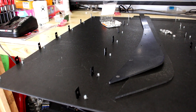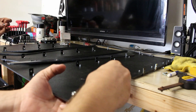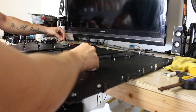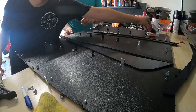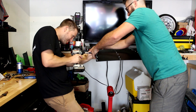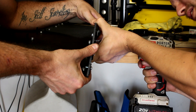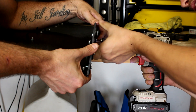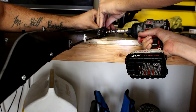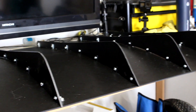You have to install all the nuts on the bolts before you do the fins, otherwise everything starts getting in each other's way. We use nylon lock nuts here — maybe it's overkill, maybe not, but it seemed appropriate. Next, go one by one on the fins and fully bolt them into the diffuser. This is where it helps to have a friend clamp everything together and get the bolts in — repeat that for every single fin. And the main structure is pretty much assembled, so the next part is actually mounting it to the car.